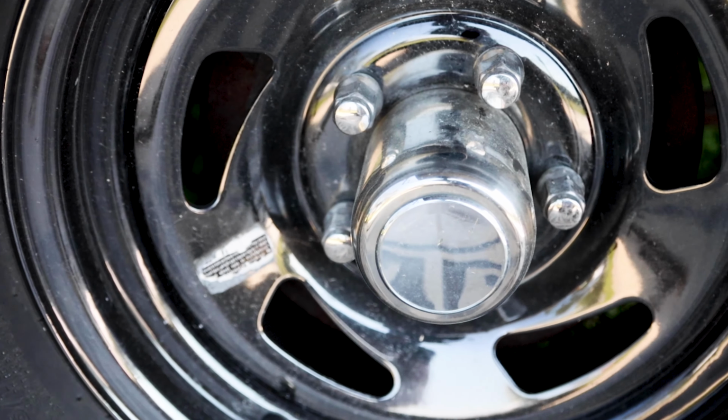so that you can get the tire off. As I said earlier in the video, I have a tire iron. Now my lugs on mine are 3/4 of an inch. That means that you need to have something that will be able to remove those lugs. Now you can get yourself what they call a 4-way. It looks like a plus sign with 4 different lug sizes on it. That is actually something that you should really get yourself, because not only will it fit your camper, but it will probably fit your tow vehicle as well, just in case you have a tire problem there as well.